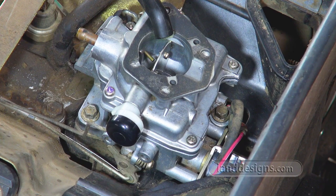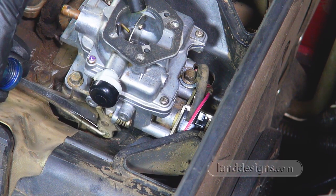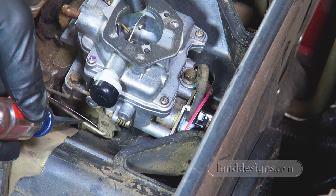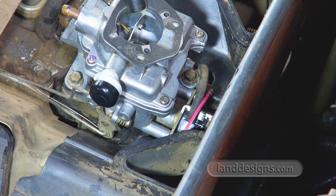All right, we're going to have to pause the video and figure this one out. I went back and looked at the video of when I took everything apart, and this throttle wasn't really touching the end back then anyways, and I don't see anything I could have done differently for what I was doing in here, so I'm going to have to say that that's the way it was. Worst case, hopefully I clean the carb out enough that if it'll start, and if it doesn't work, it'll limp, and I can take it to somebody who can fix it for me. But I believe that this is connected the proper way, that maybe there's some kind of a governor or a vane that senses the flywheel speed. I don't know. So maybe this lower linkage isn't really supposed to move that much. I mean, it definitely, if I move, but that's the choke, the throttle.